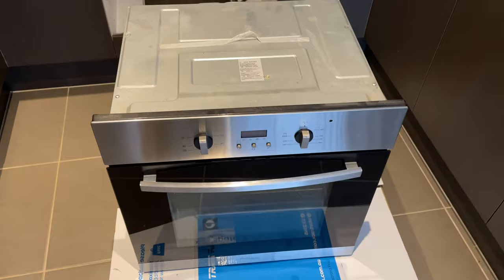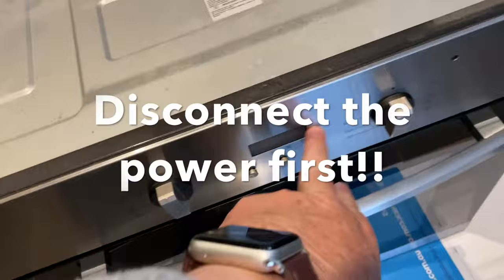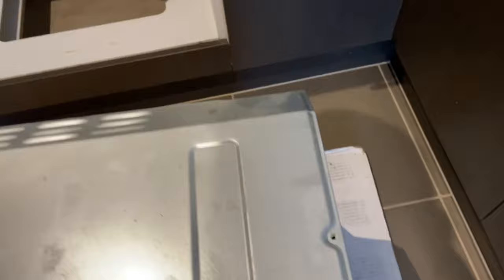If you're wanting to service your oven once it's out — like getting to the control panels and modules — you can see you just take these few screws off the top and a couple at the bottom, then this top plate will come off and you can get into the modules if you're going to replace a clock or replace components in the top there.